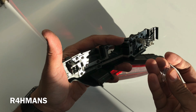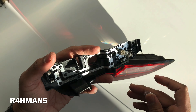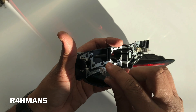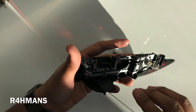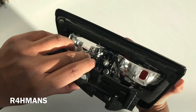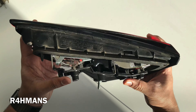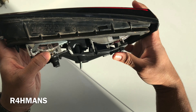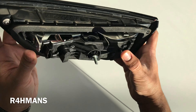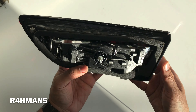Put the right side and left side pins in, push it down, and turn right to lock it in — that's how you fit the new H21W. Obviously I haven't got new bulbs here because these are working, but if yours aren't working that's how you change it. I'll link the bulbs in the description below. For the 501 it's literally a push-in and you're sorted. When putting this back make sure it's the right way — turn it around, confirm the bulbs are seated in their slots, push it down, and it's clipped on and won't be moving.